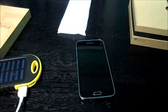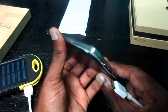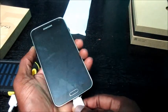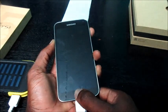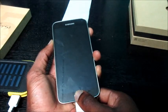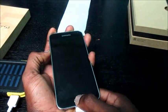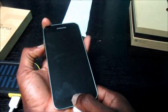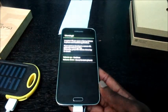I did this technique on an S7 as I mentioned. I'm going to hold the Home button and Volume Down as I plug in the charger. You can use a computer or your wall charger. Keep holding — if it's not charging or not coming on, just give it a while. Keep holding Volume Down and Home, then press the Power button. Press all three buttons together — and we can see the device came on.